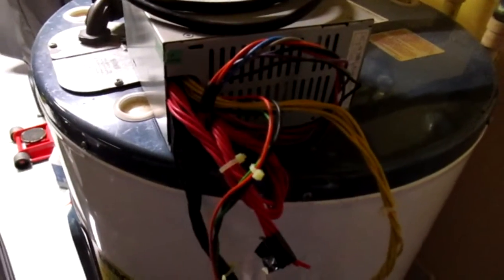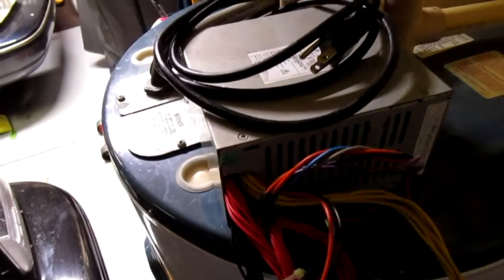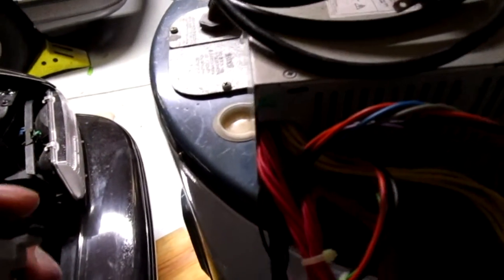Hopefully I have enough light over here — this garage sucks. But this is my little ghetto radio power supply. It's an old computer power supply, so it converts whatever voltage is coming out of the wall — that can vary depending on your power company, not by much of course — and yeah, it spits out 12 volts. So I rigged it all to 12 volts.